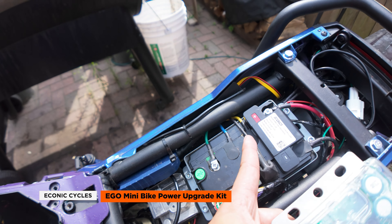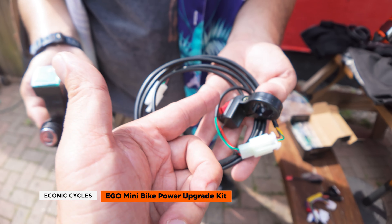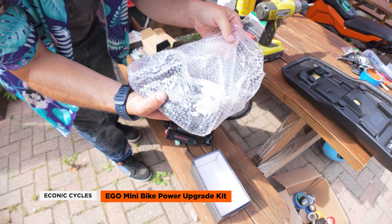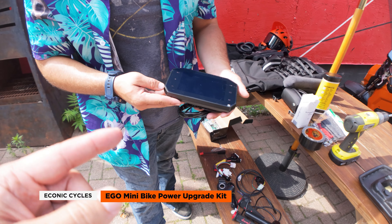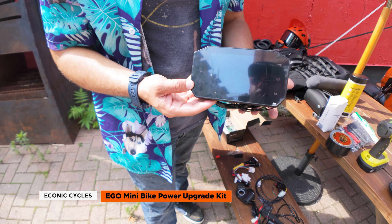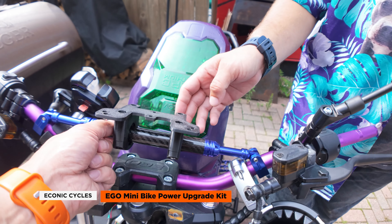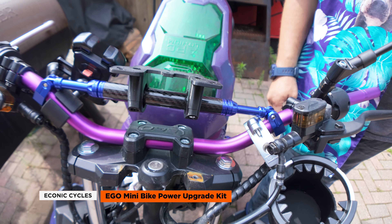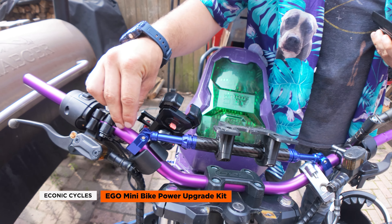We have to remove the phase wires and the power wires, and then we have the harness for the Far Driver. Also part of the kit is the ignition switch with the voltage display, the three-speed switch, and the full-twist throttle with domino grips. Tom also opted for the Chaoji display. You don't actually need a display to run this kit, but it's helpful because the stock Ego display is not compatible. On the website, as an option, you can get the handlebar mount at the 7/8ths sizing, and there's even an option for a razor mount. Tom found an adjustable Amazon mount that also helps with stability.